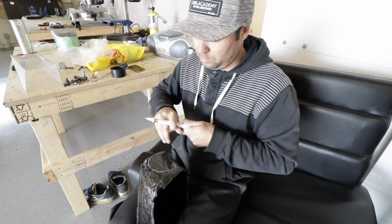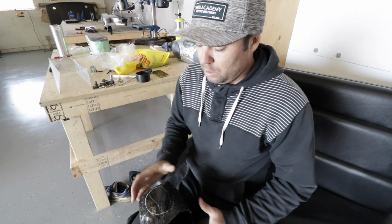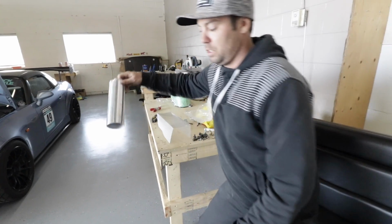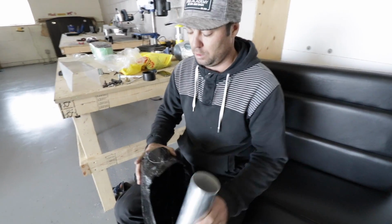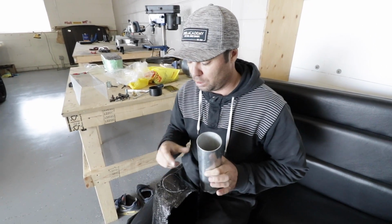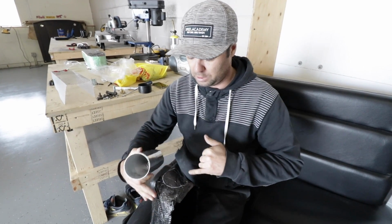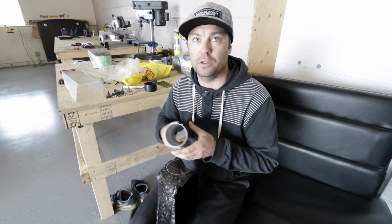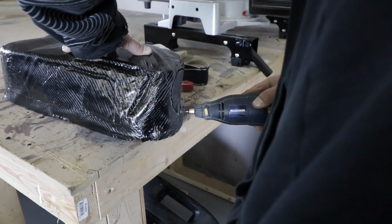So I guess you're thinking of starting with the front end of the box, figuring out the inlet? Yeah, I'm gonna put the inlet in. I'll use this as my form, so I'll push this in through here. And then I'll make my radius that I want out of tape. I'll lay that all up, pull this out the back, cut out all the stuff that's behind the radius, and then smooth that all in, and we'll have a nice transition to our 3-inch oval for the intake piping.